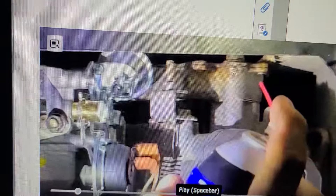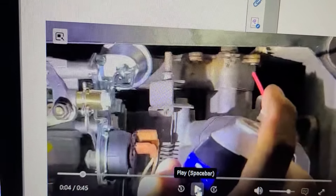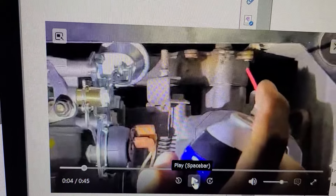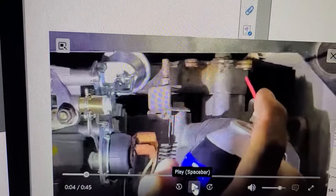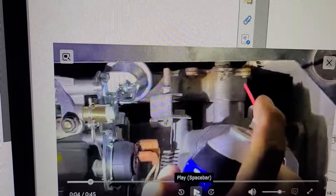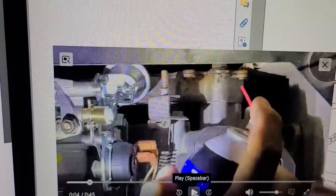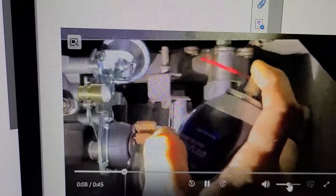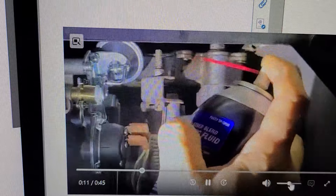As a tip, I told him to try spraying some starting fluid on it, because if you have an air leak and spray starting fluid on it, you can make the surging go away momentarily. I noticed he was just spurting it in little bursts — maybe if he continued spraying it could make the surging go away. But you'll see what he found in the video — that's the constant surging.